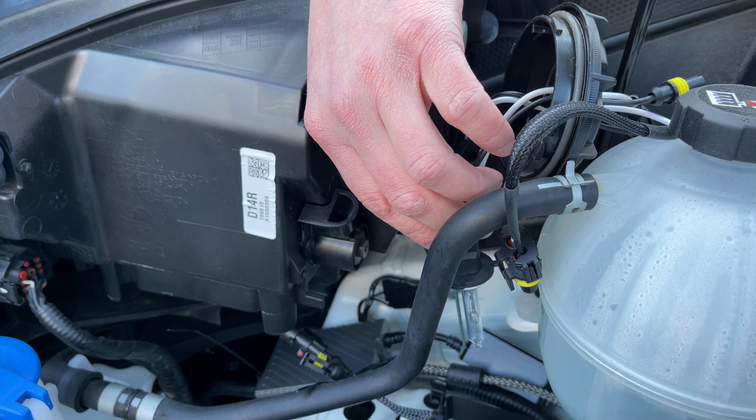Now you can do it with your car. I would highly suggest that if you do it, you make sure that you're only doing it for your car if they have projectors. Okay, these are projectors. You don't want to use these in cars that have reflectors. Those are usually typically bigger, and then you got the reflector, you got the bulb that comes out through the middle, and then it shines into the reflector and then out. So if you use HIDs in that, then you're just going to be scattering light everywhere. You're going to be blinding everywhere.